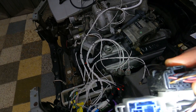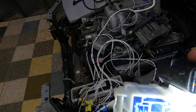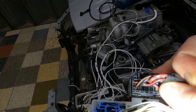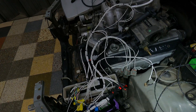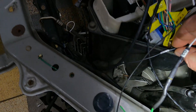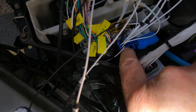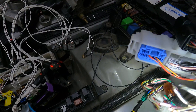Those are power wires. Down at the bottom there's also a red with blue, which is also power. On the wideband harness I've labeled it black pin eight, and it's got the correct terminal on it. At the moment it's plugged in there to get power, but in the actual application you're just going to move the white frame out of the way and get access to this bottom plug.